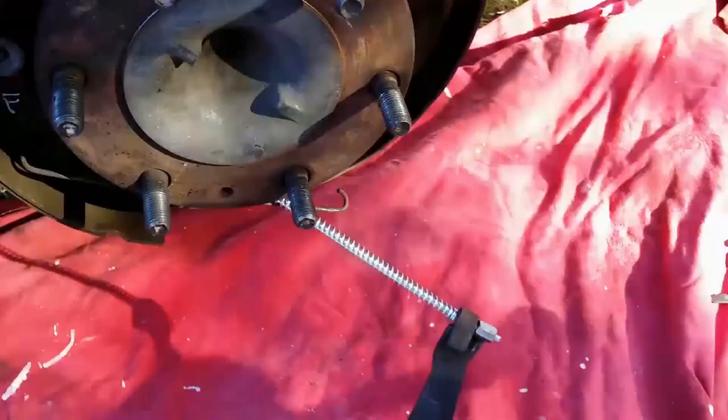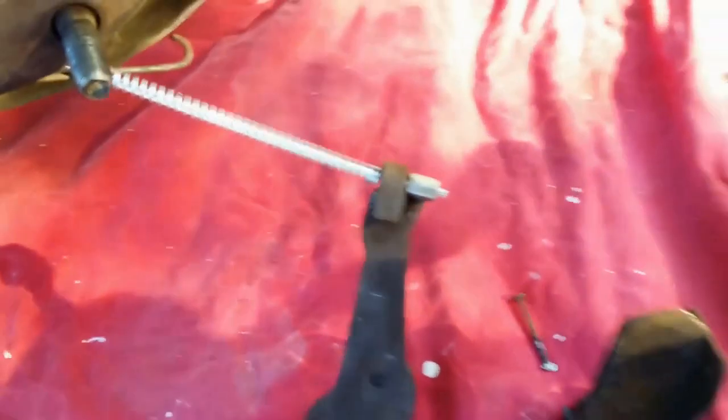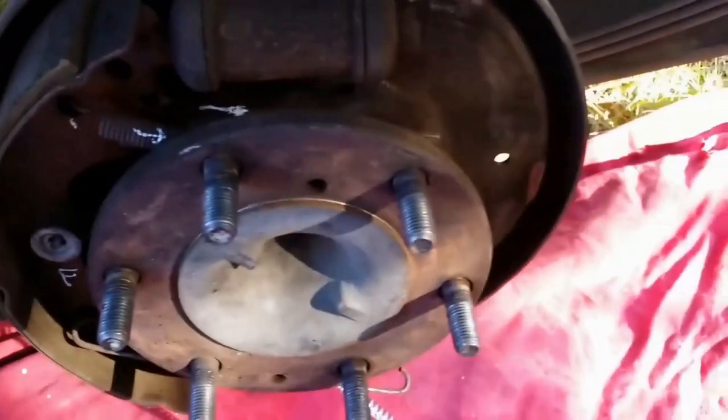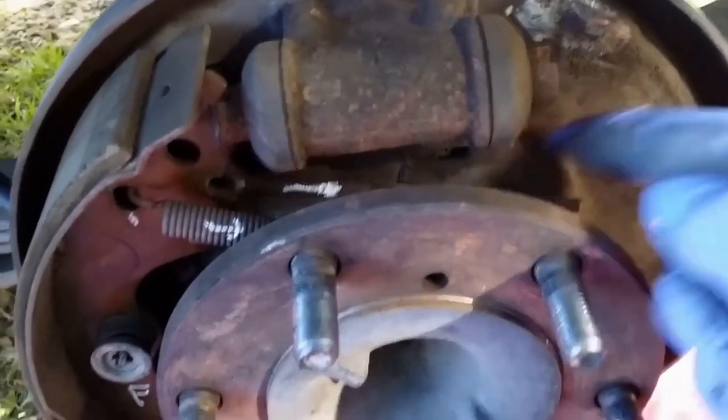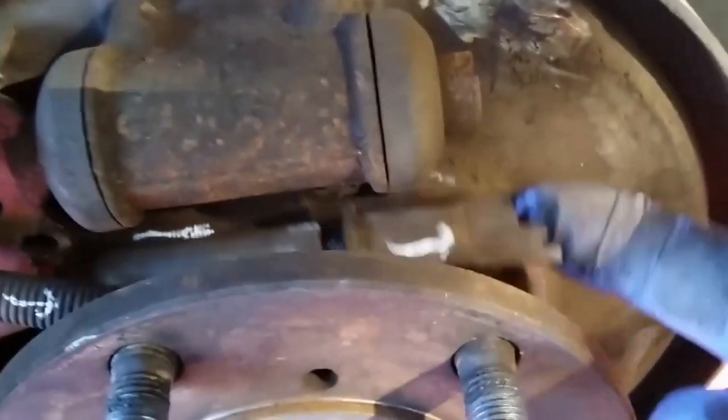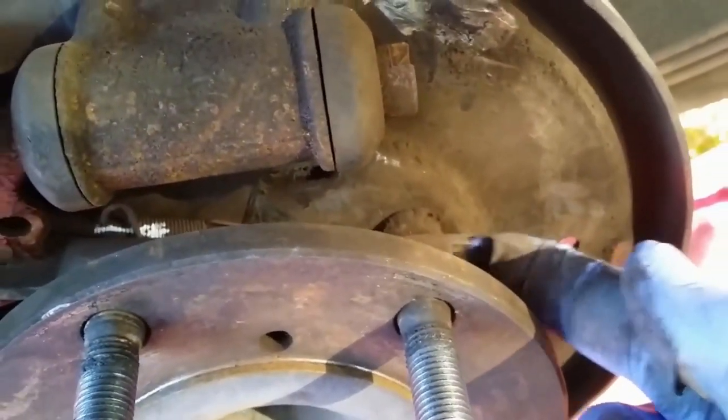The hardest part as you put the shoe back on is this spacer here and this spring behind — you have to sort of line it up and get it all back on. There's a cable through the arm of the shoe now — I'll just get it and flip it around and put it on the drum frame. I think what I did last time was I got this small spring, put that on first, and then used that to lock the rest in.